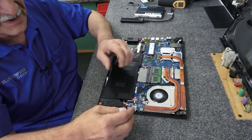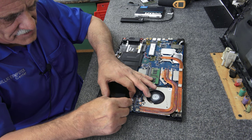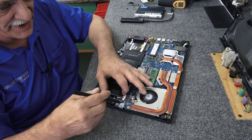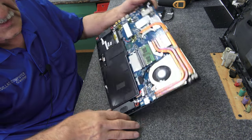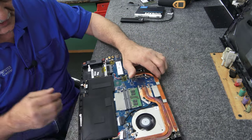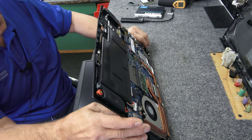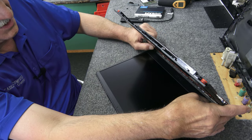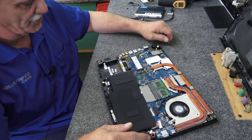I'm going to disconnect the battery just to show you. If you get your fingers and fingernails in there you can jiggle it out without too much difficulty. I got it disconnected. Don't put any metal or metallic tools in your computer. If you're going to disconnect the battery, gently open it up, then hit the power button a couple of times to discharge any leftover charge floating around — just to make sure. So if you accidentally drop a screw or screwdriver on the main board you're not going to break your computer.